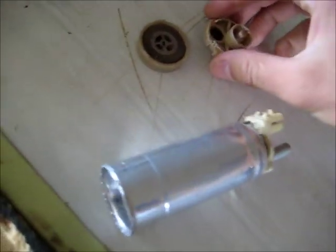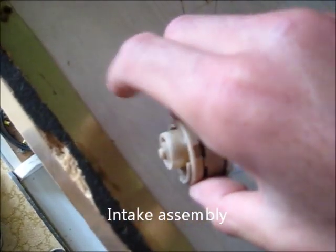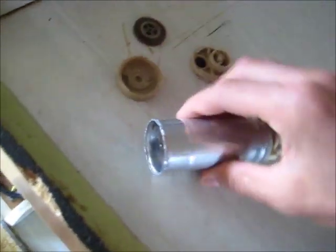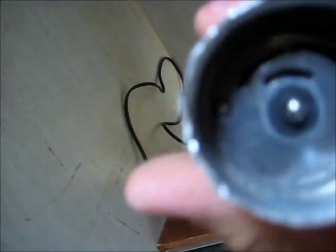I'm going to do a bit of an equipment autopsy. This is an old VS Commodore fuel pump - I've taken the pump front assembly off it. That normally went in there. That's the end plate with a little one-way valve, and that's the impeller. And that's the back plate that goes against there - there's like a little oil pump in there.